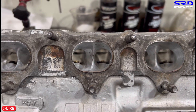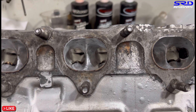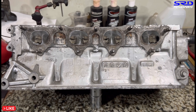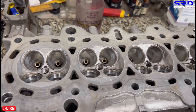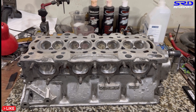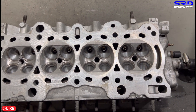We could try to hog it out to make it look big, but that would kill airspeed. The exit speed won't be good, and the goal here is to have good exit speed so the engine can be efficient on its own. This head now needs to go to the machine shop for resurfacing and other details. We cleaned up the chamber — there's a detailed chamber video in the members-only section along with valve seat and three-angle valve job videos. Let's take it back to the porting bench for a final cleanup — a few more passes at 120 grit just to make sure everything is consistent and clean.